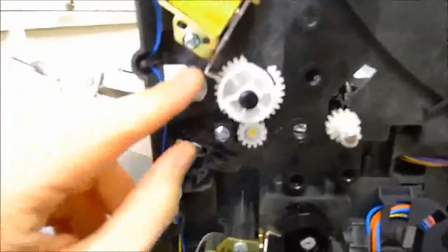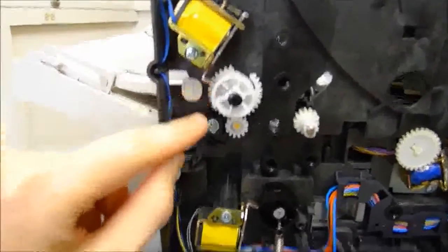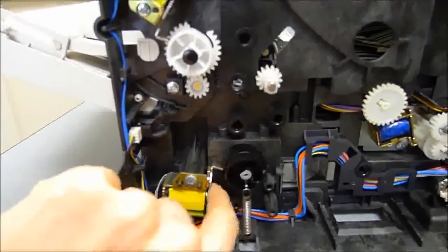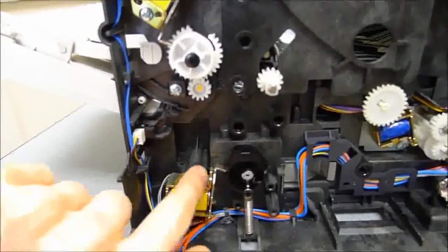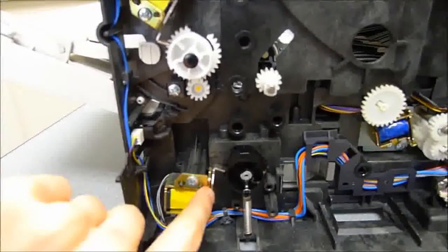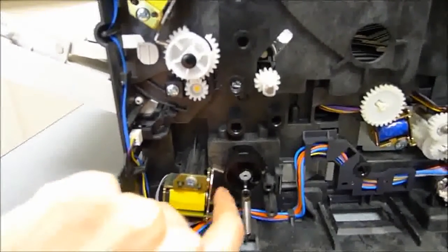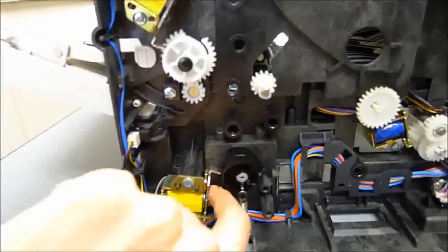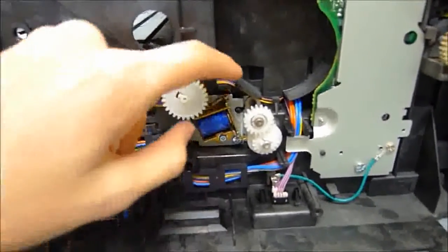These solenoids here help hold the gears in place. These gears get held back and forth by these solenoids, which are little magnets down here. Originally when HP sells these, there's a little tiny bumper that basically prevents noise. But over the years that bumper gets worn down, and then all that's left stuck on the metal is the adhesive that originally held the bumper in place.